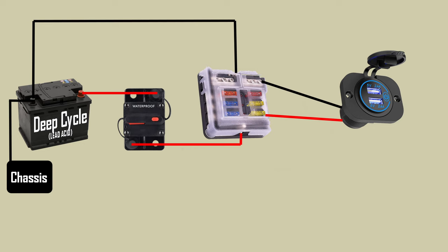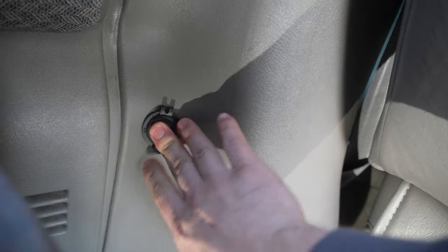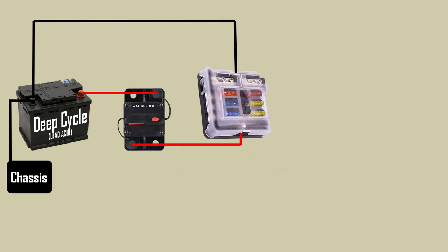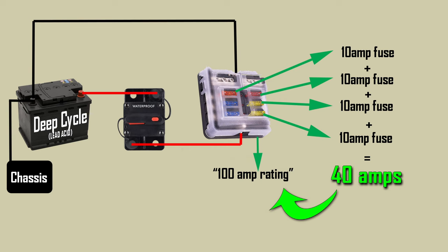We're going to take a positive wire from the fuses with the appropriate size fuse for the accessory you want, and then a negative wire to the negative bus bar in the fuse block — connect it up, find a place to mount your accessory, and that's all there is to it. One thing to make sure you do is total up the amperage of all the individual accessories you want to wire in and make sure that total does not exceed what the fuse block is rated for. Likewise, make sure the circuit breaker you installed before the fuse block does not allow more current through than the fuse block is rated for. It's simple addition — add up your totals and make sure nothing exceeds what it's rated for.